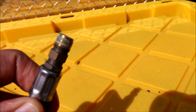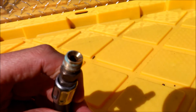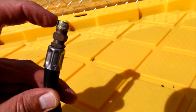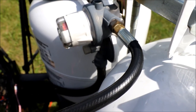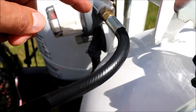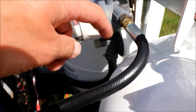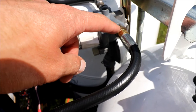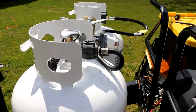Luckily these are pretty common — the hardware store had them. Looking at this end, you can see a rubber O-ring that's all cracked — that's where the gas was leaking from. One thing I don't quite understand: there's thread sealant on the fitting, but if you look inside it's cone-shaped, so it actually seals on the inside. I replaced mine and also put thread sealant on, but when threaded down as tight as I could get it, it still leaked — probably because the sealant goop prevents it from bottoming out to make the actual seal. So if you use thread sealant, use it very sparingly.